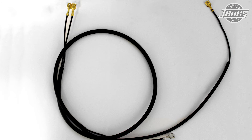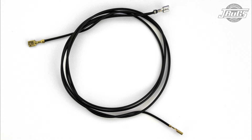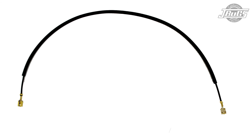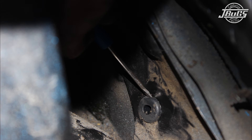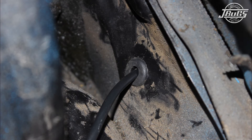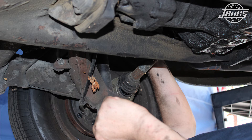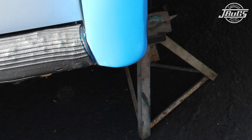Reverse light wiring has three separate wiring harnesses. One has two black wires and a black sheath. The other harness is a length of black wire with three terminal ends — one at either end and one in the middle. The last is a single-sheathed black wire. The sheathed harness with two wires will push through a grommet in the lower right side of the engine compartment — this is behind the fan shroud and not often easy to see. At this point, you'll most likely have to jack up the car to hook up the wires underneath the rear of the car. If you do, be sure to use jack stands and leave the car up on jack stands, as you'll need to hook up the starter wire later.